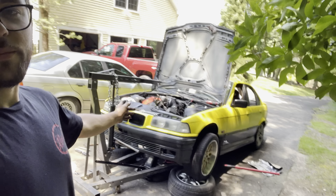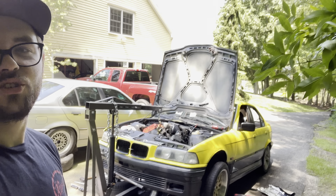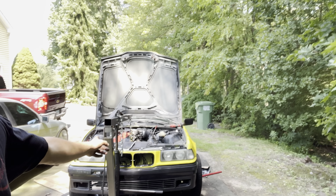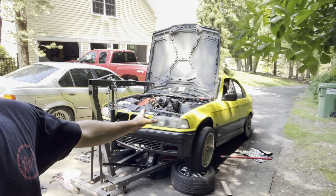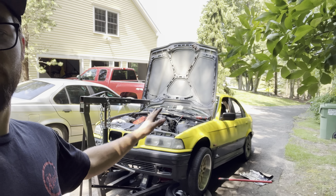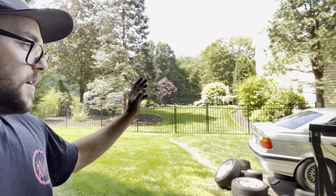This morning I finally got it in. What was happening was somehow the car had shifted on the wheels while I was doing the subframe, so it pulled the whole subframe about an inch or two to the passenger side. I had to get all of the pressure off from the engine, disconnect the struts, and get the car up in the air. Luckily the subframe's in now — I have three of the four bolts in. Then I'll be able to lower the engine down, bolt on the steering rack, bolt the suspension back up, and we're gonna have a working E36 again.